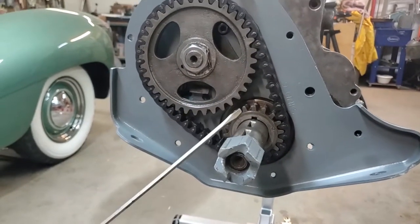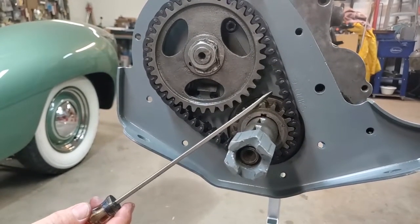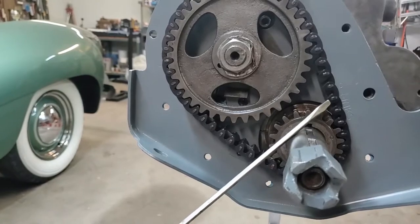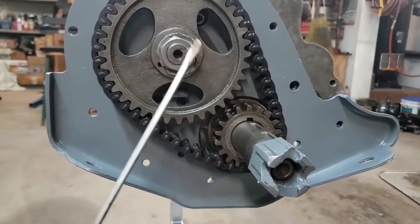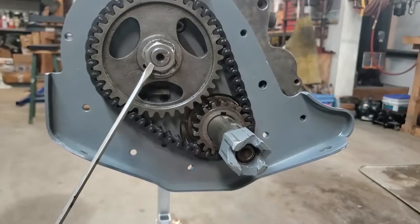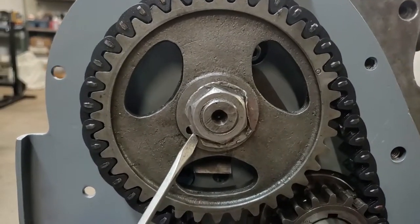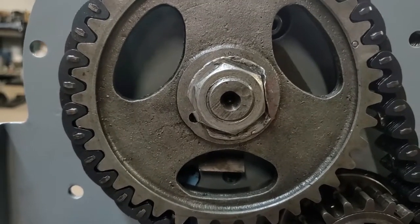To install the two gears, because the timing chain has a center piece that locks into the center of each gear, you have to assemble both gears at the same time with the timing chain on there. It's a little fussy, but if you've done everything right this is what it will look like. The only one tied down permanently so far is the camshaft gear, which has a special lock with a tab you fold up and a nut.